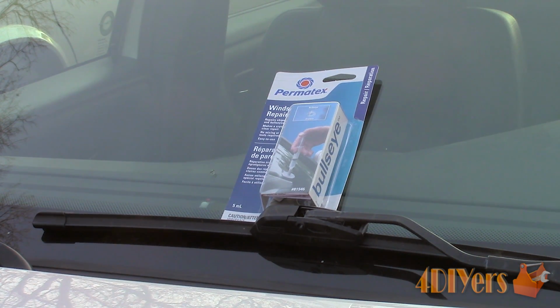The risk of a windshield developing a crack can greatly increase over bumps in the road or extreme differences in temperature, such as driving in the winter with your windshield defroster blowing hot air. It is important to have it fixed right away. Also, if the stone chip is exposed to exterior elements for a longer period of time, it can fill up with dust, therefore not making the repair as flawless.